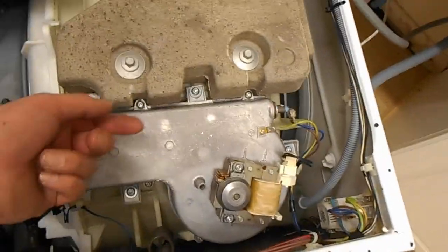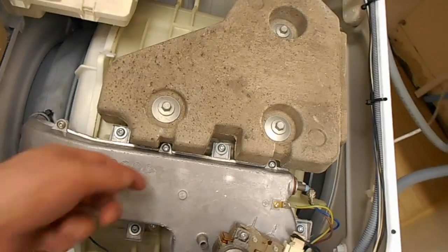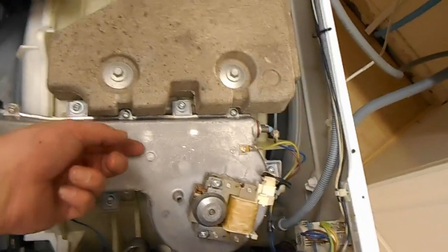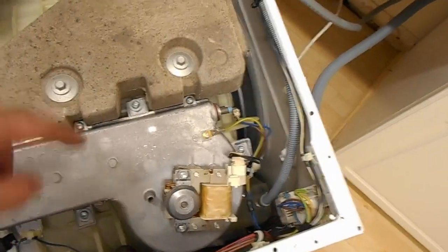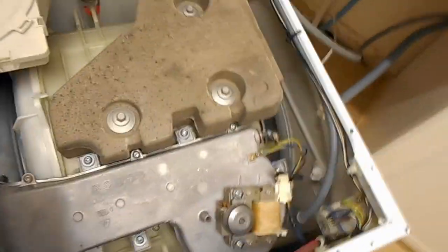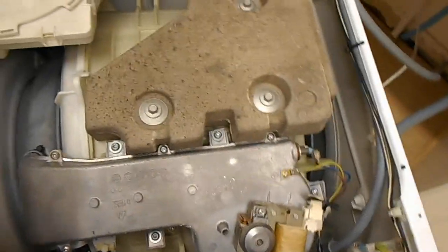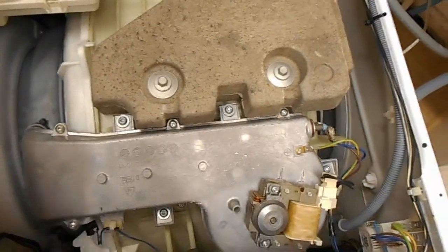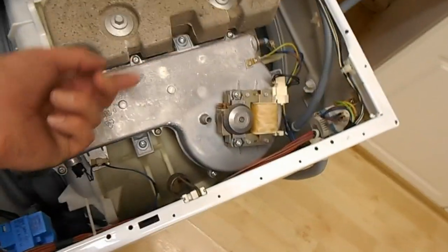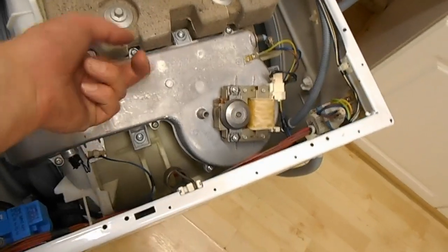And that's why when you turned it on hot it would come up with a thermistor fault, because it would barely run the heater for a few seconds and instantly come up as being up to temperature. There's obviously a programming routine in the control board which says, well, there's no way it can come up to temperature that quick, something's wrong. So it just says thermistor, it's a temperature issue, because it can't tell why it's getting too hot too quick.